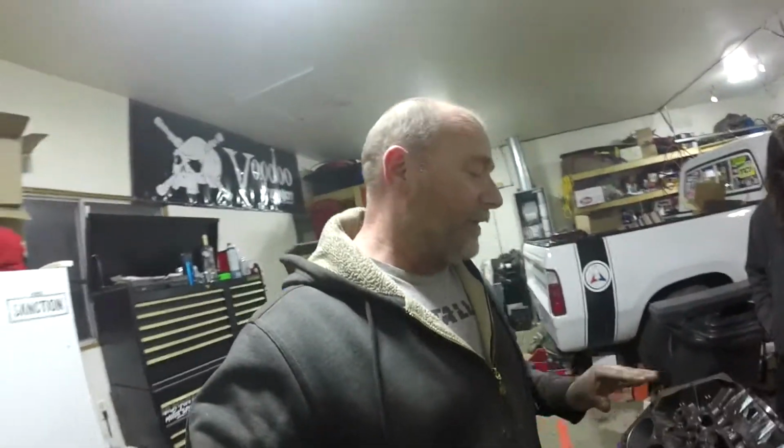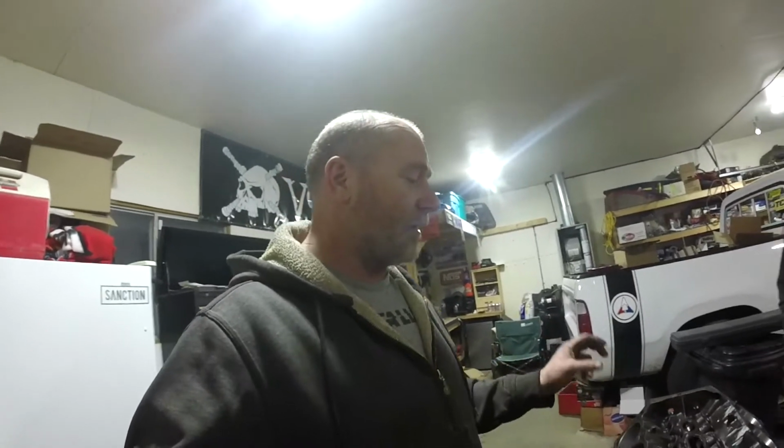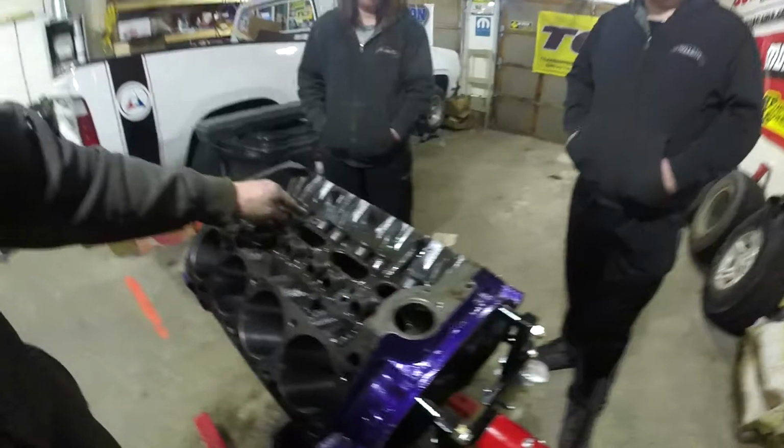Okay guys, so that's where we're at right now. When we revisit this after hot tanking, we're going to install the brass fittings that go in here. They're simple: just 45 degree 1/4 inch pipe thread brass fittings, male on one end. They screw into the engine block here and here, and the other end of them is for a 3/8 compression union, and we fit a 3/8 copper pipe in between.